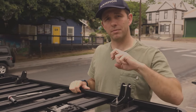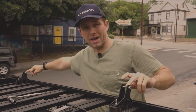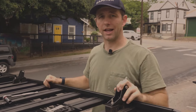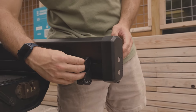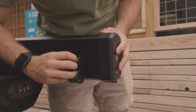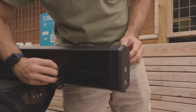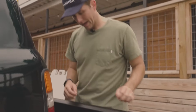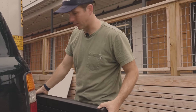Now we're going to take those talon mounts, slide them onto the back of the awning, and measure them to match the spacing of the base hardware so we can easily latch this on. These two square nuts we're going to slide into the back of our profile like so. You may need to loosen the bolt a little bit if it's too tight — just slide it right on, measure them out, tighten them down, and then drop them onto the base of our mounting hardware.